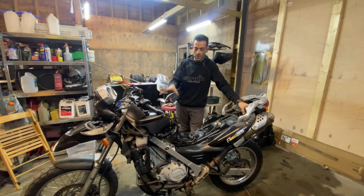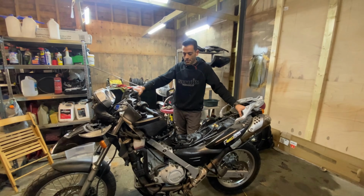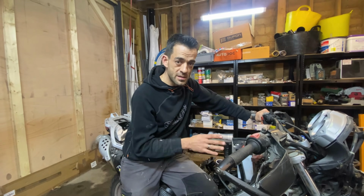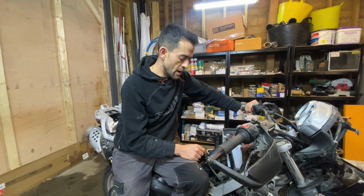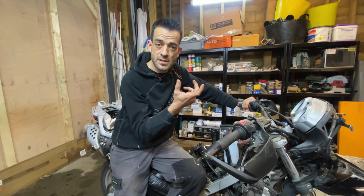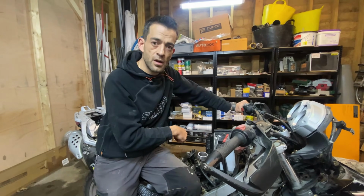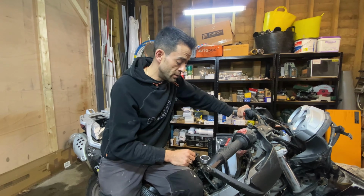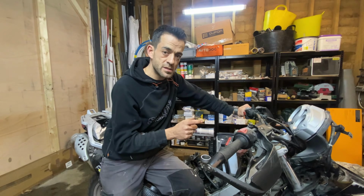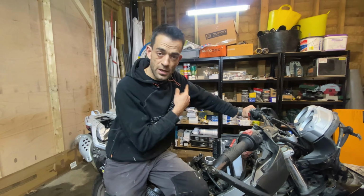You would have seen how we tried to start the vehicle. We had to solder up some wires, tidy up some wires, just so we could try get this thing fired up. I'm hoping and believing that it's the cylinder head gasket on this motorcycle that's gone. Or all the piston rings have reorientated themselves where they all line up and the gappage is incorrect so badly that we're forcing the air down. Or there's a lot of wear on the barrel, and between the barrel and the piston there's so much play that the air just goes straight past it and shoots out oil.